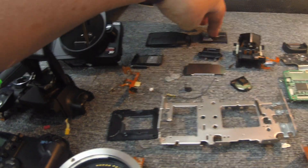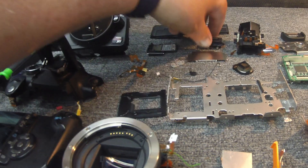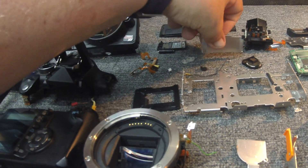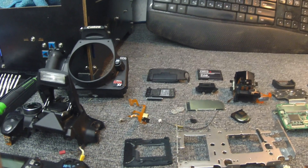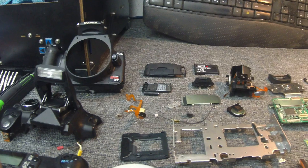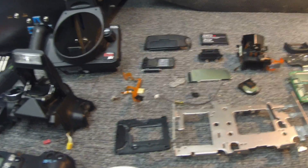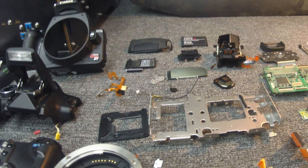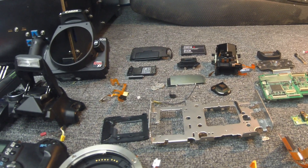Here's one of the covers on the side. I just put the compact flash card there. This is the cover for the battery. This is the viewfinder. This is the one shield I had to unsolder to get the CCD — the main camera CMOS — out of it. That's the only place I had to unsolder. I had to unsolder that shield to get the two cables that were connected behind it unplugged.